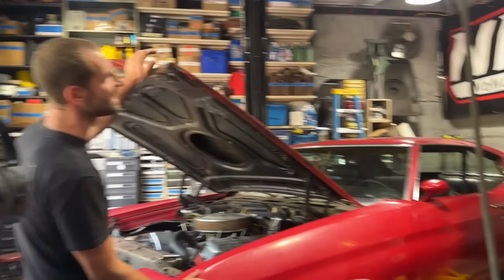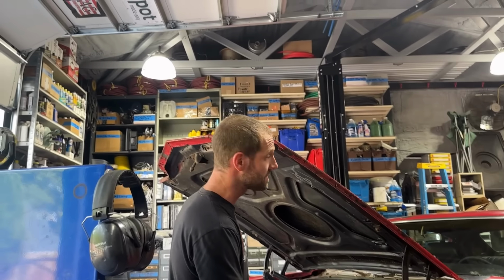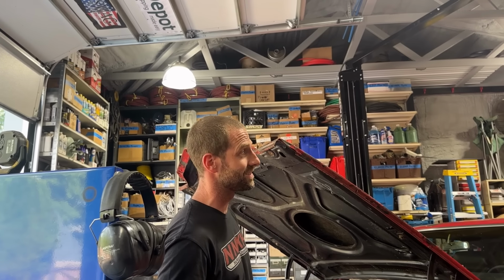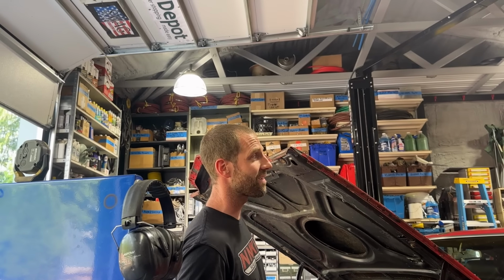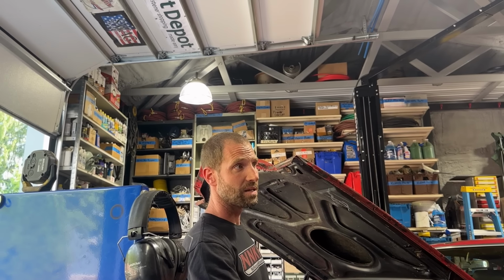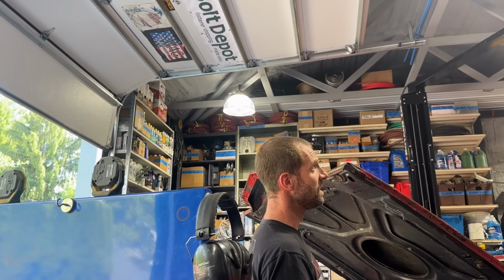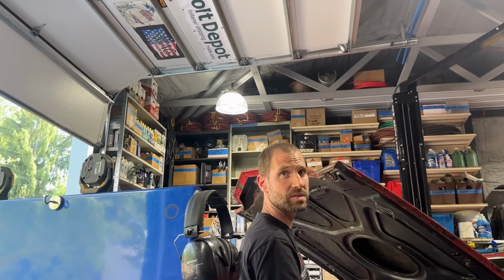Just being a 10K, when I put my Ram on here, which is about 9,000 pounds, I put support post jacks in to supplement, but it still feels like a lot. I'd rather have a 12 or 14K. I was used to the in-ground lifts at the shop I worked at, and those things were stout. They were rotaries, but it was such a different animal. When this is up, you get a lot of rock on these posts.